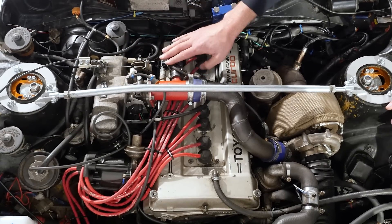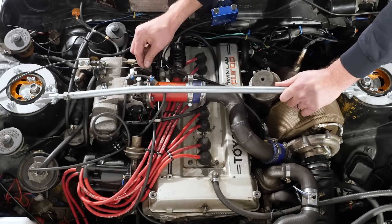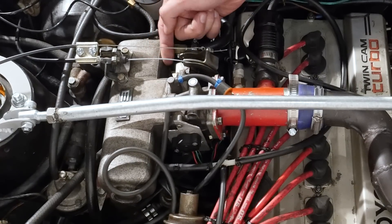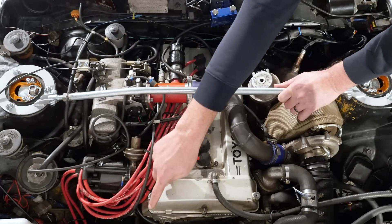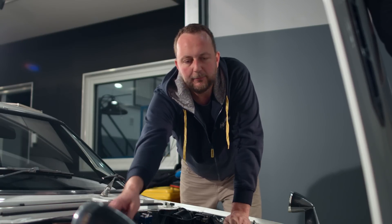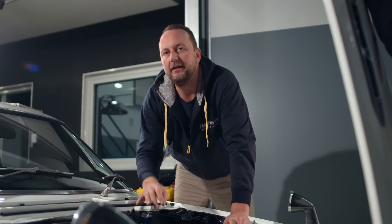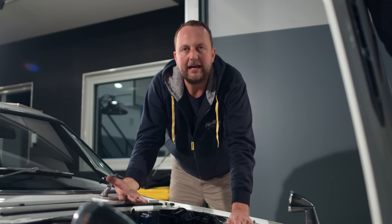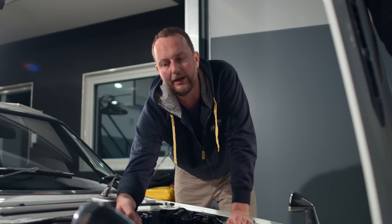If we start over this side, we've got a factory intake manifold coming through a factory cable style throttle body. We've got our normal cable here coming from the throttle pedal, and over here there's a second cable — this is something that used to happen back in the day. That second cable runs all the way around down to a valve at the bottom. That's actually an aftermarket cruise control system. There's going to be a little computer and probably a little stalk in there somewhere to do the cruise control configuration — something you don't see every day now, where normally we'd add an electronic throttle and it'll all get done through the engine management system. This was a full mechanical way to do it.